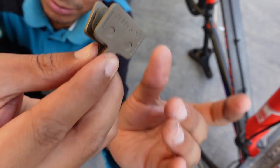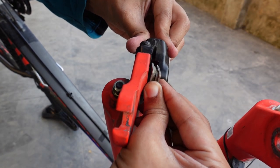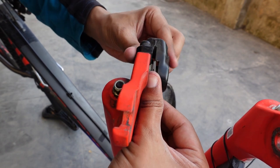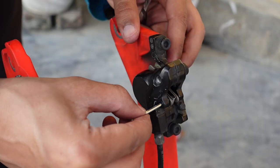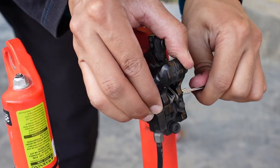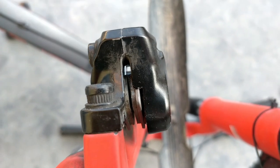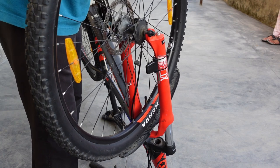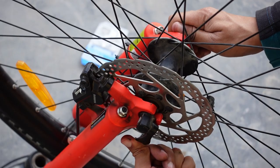We keep the brake pads and springs together. The springs help them fit. You can then see the disc brake pad slots. There is a hole at the back where you put the clip last, and you can remove that clip to remove the old disc brake pad. Then you put the new disc brake pad in and push it gently — don't force it, it will set into place.